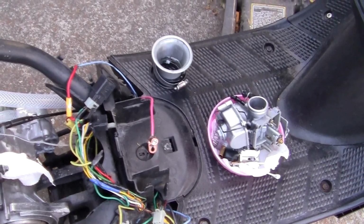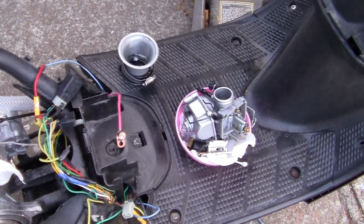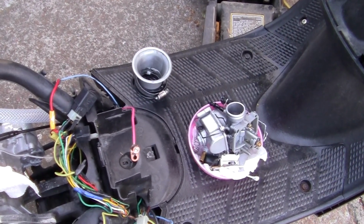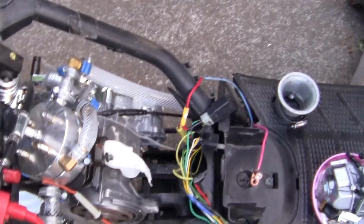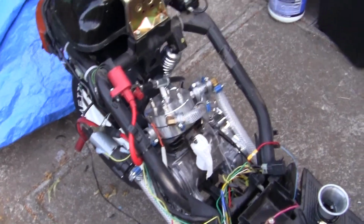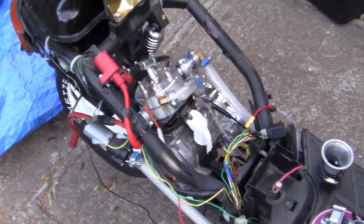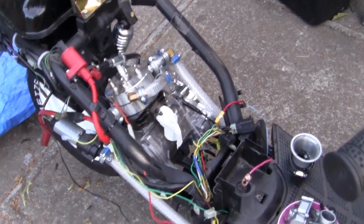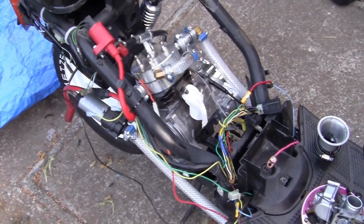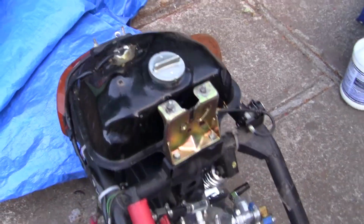It's green. You go down to a local airport and you want to go to the part of the airport where they have private planes, and they have a big 5,000 gallon tanker that fills up the planes. And you just tell them, look, I got 5 gallons here. Bring a bunch of change if you're going to do this, okay? Don't bring them a $20 bill. Bring them a bunch of ones, a bunch of quarters, things like that. And they'll charge you, say, if normal gasoline is like $4 a gallon, it'll be $5.50, $6 a gallon. And what you do is you split the low lead 50-50 with your regular gas. And of course use whatever oil you're going to do.